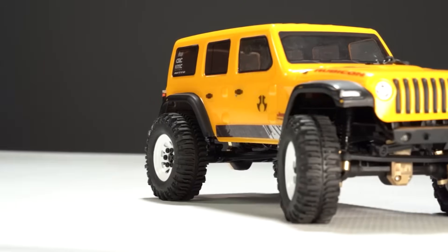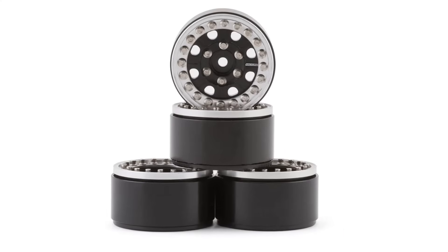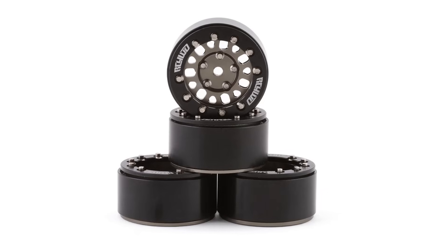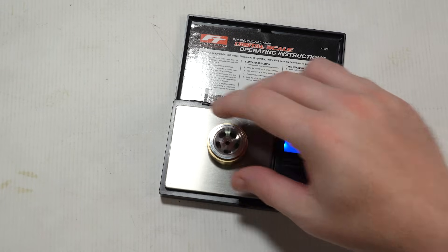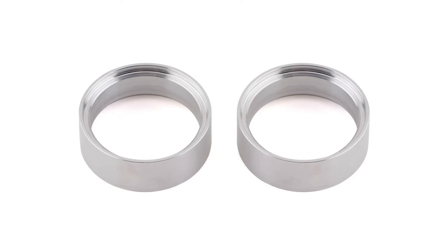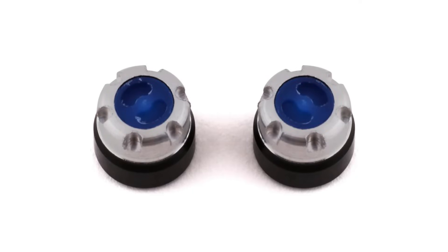Another great way to boost performance and styling is with wheels and tires. In Part 1 we talked about the RC4WD stamped steel wheels in black and white, and since then RC4WD has released those same beadlock wheels in silver. New options also include the Raceline Monster beadlocks, the Breaker 1.0s, and the Competition 1.0s — though those are pin drive rather than hex. The SSD beadlock aluminum wheels come with an included brass ring, weigh 24 grams, and are a great way to add weight down low. SSD also offers lightweight aluminum rings if the brass ones become too much. For extra wheel detail, SSD offers locking scale hubs in red and blue that replace the 4mm axle nut, but require the special SSD locking hub tool. Note that the hex tolerances on SSD wheels are too tight for any other brand's aluminum hexes.